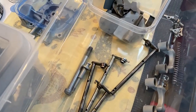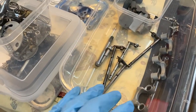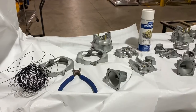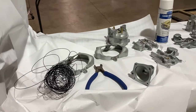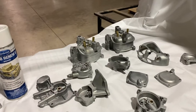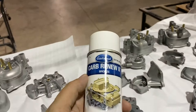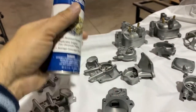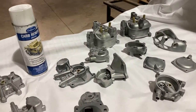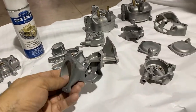We'll keep working on all the parts — basically parts for four carburetors — and keep all the hardware stowed in containers until we're ready to start putting them together. Once the parts are cleaned and blown out with compressed air, we prep them to spray what's called Carb Renew, which kind of duplicates the appearance of the original plating.